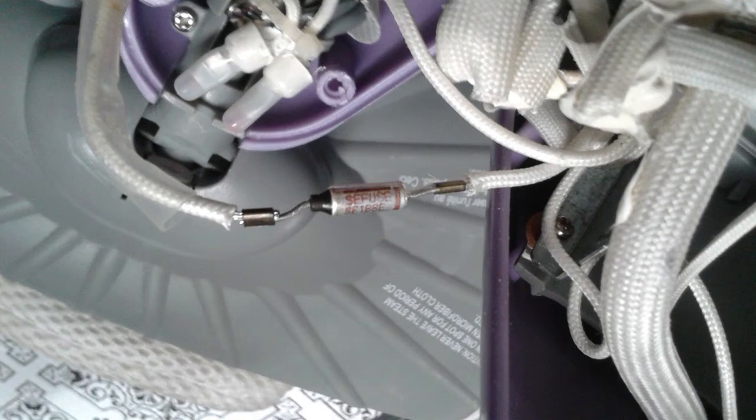Once you remove the clamp, then you can very carefully unwind the yellow cellophane film, and then slide this clear vinyl sheathing off to the right, to the left in my case, and you'll expose the thermofuse as you're seeing it here. And there's what you're going to replace. You will clip the ends of the thermofuse and then use the barrels that you've made in the first part of this video to reconnect the new thermofuse to the wire as you see it. And then the reverse is the installation.